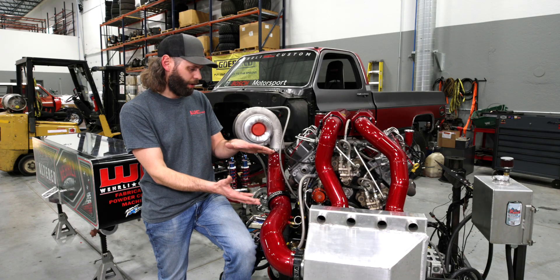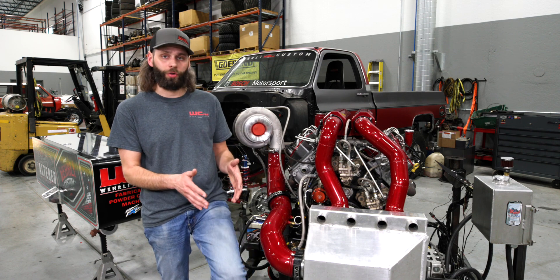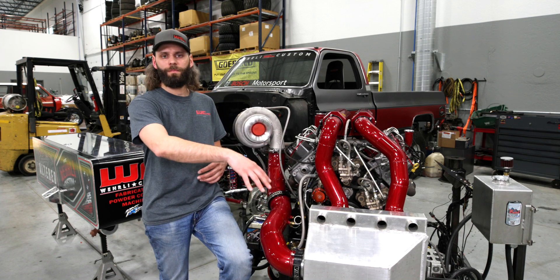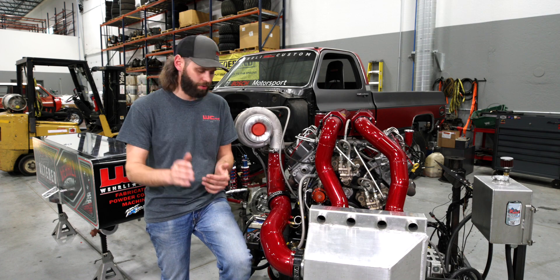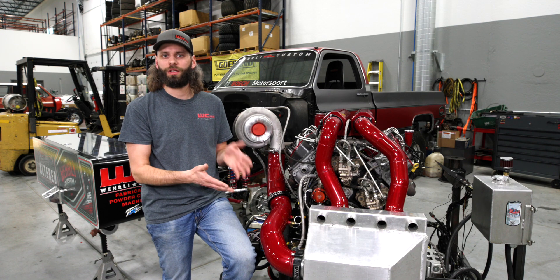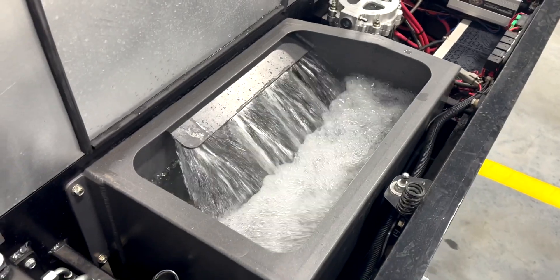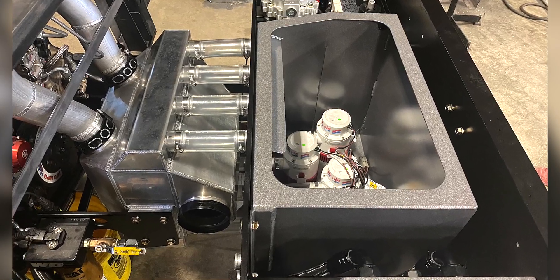The intercooler is mounted fairly low in relation to the engine — it's between the frame rails right in front of the engine, and that works out really well for mounting your icebox. If you mount your icebox directly in front of the intercooler in your weight box, all the weight of that water and ice is as far forward as it can be. You're able to run your pumps directly into the bottom of each inlet. You always want to feed your intercooler from the bottom so the core can completely fill with water. We have our icebox in the front in the weight box and four electric pumps that feed into each lower port of our intercooler, filling that core up from the bottom.